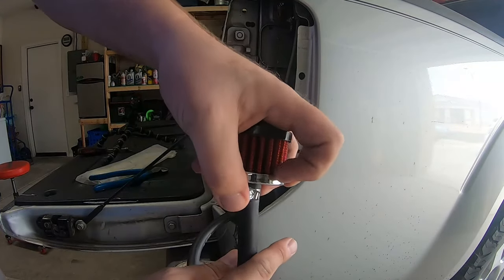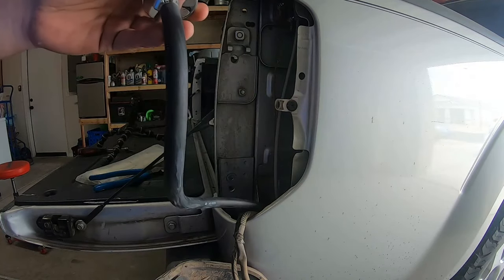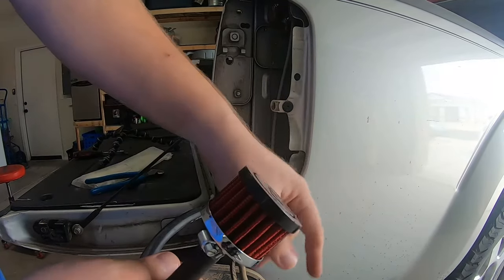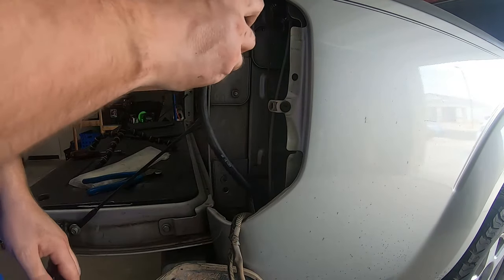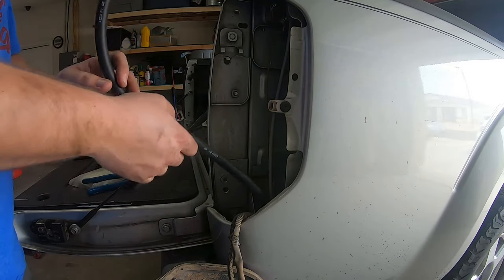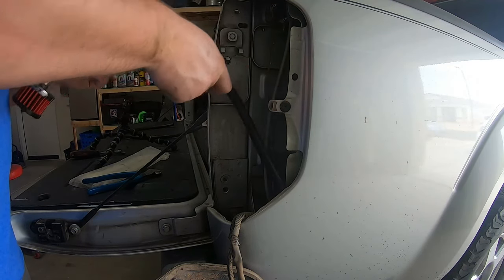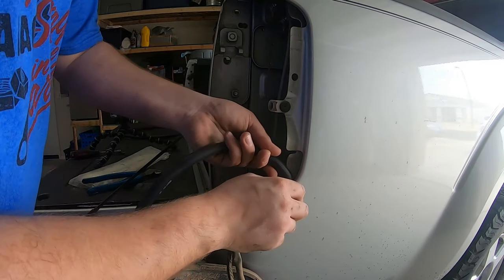As you're driving along, your axle and differential can vent way up here. If you go through water down where the old breather was, it's just going to splash — you're still going to get dry air from up here in your taillight housing. Very handy contraption. Now we do want to make sure that this doesn't fall down, so secure everything with zip ties.